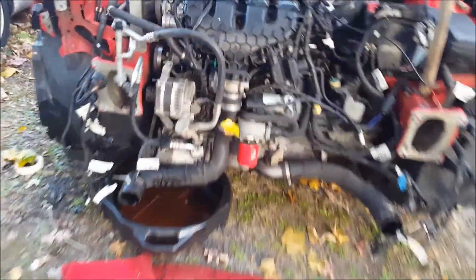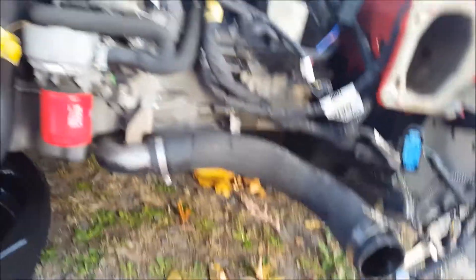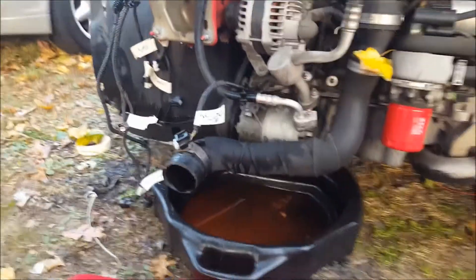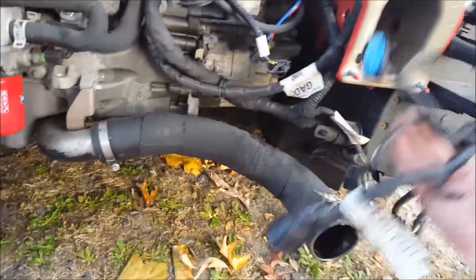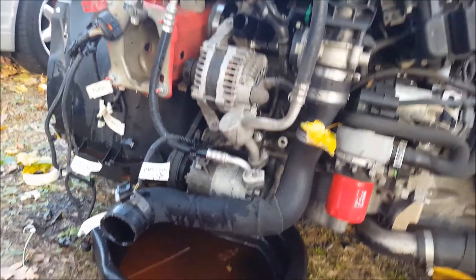Now we're left with the whole front end of the car. I'm gonna remove various things from here, remove the bottom from the other side. Whatever's connected to the shifter plate, all that stuff, and the rest of the battery tray. This is how far I got right now — took the whole front radiator support off. There were like eight bolts, a computer held on the side, all these harnesses. I labeled everything, took videos. So yeah, we're here now.